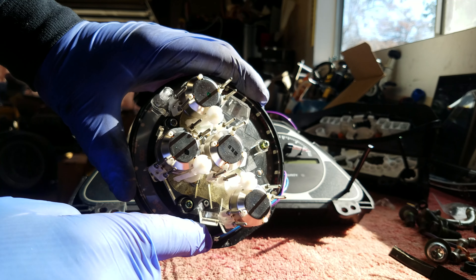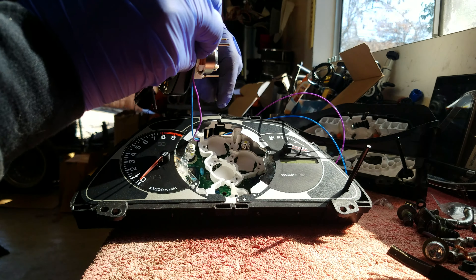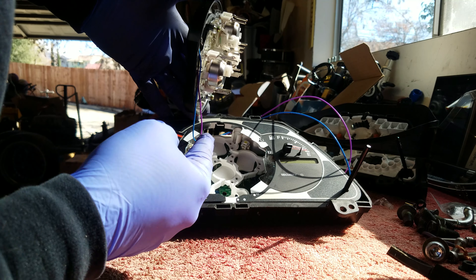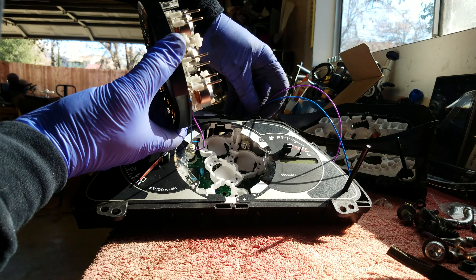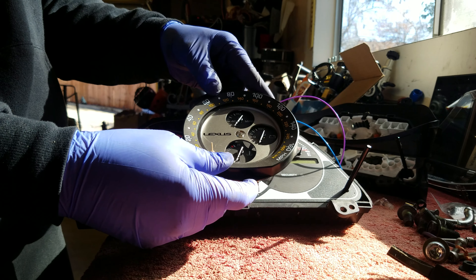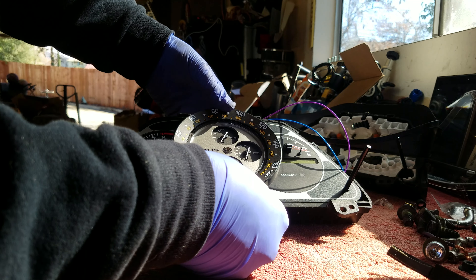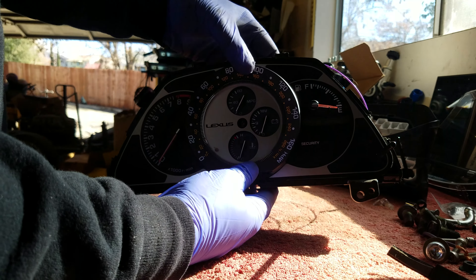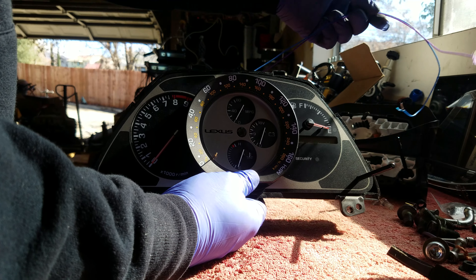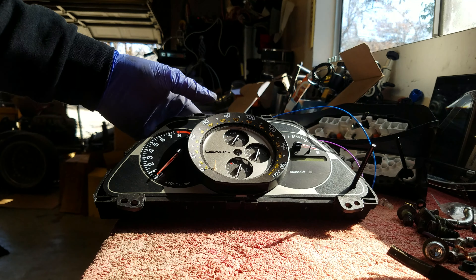If you just had some flying leads on the end of the LED, it would have been a lot easier. I had to heat up some of the plastic sheathing — this one was designed to be an extension of another harness, so it actually had a male-female plug on it. As far as wiring out the back of the dash, honestly, that was the easiest part of the whole thing. With the leads terminated out this direction, I just lay it right through the top — super simple. They don't bind with anything; I just made sure it wasn't hitting the LED. Just tucked it in, rotated it around. Wires terminated out the back — now I can just run the shift light body anywhere to make adjustments.